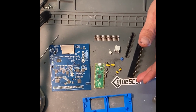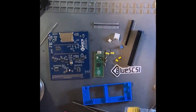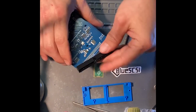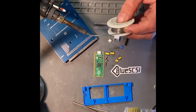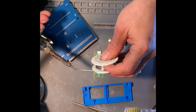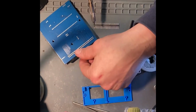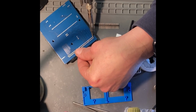Flip the board upside down, ensure the connector is still flush with the board, then solder the 4 corner pins. I didn't even turn my soldering iron on yet, so let's do that. All right, so that's the first thing here. So put the board header into that. There we go. Shouldn't be too daunting. Trying to get all the top stuff. Let's go on the iron. Get in there. Best soldering technique in the land.